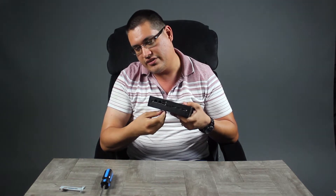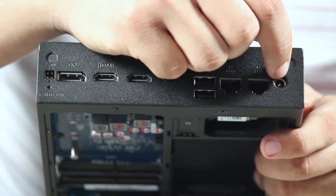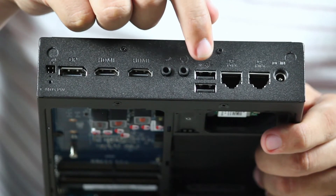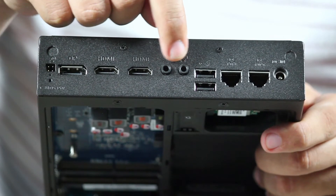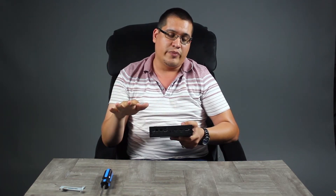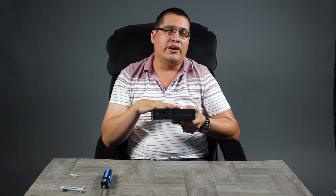The back I/O here. We got your DC in for your 65-watt power brick — that's in the accessory box. You got two RJ45s; they're both Intel i211/i219-LM, so one-gigabit capable. You networking gurus out there — I know you love the dual LAN ports. You need them for teaming, fault tolerance, or connecting to dissimilar networks — we got you covered. Furthermore, you have two more USBs here if you need additional connectivity. Two 3.5mm audio jacks for headphone and microphone, so if you're going to be utilizing any audio interface, here is your connectivity. Three video outputs: two HDMI and one DisplayPort, capable of three independent displays — an improvement over our previous generation which could only do two. Keep in mind: the DisplayPort has no audio due to chipset limitations.